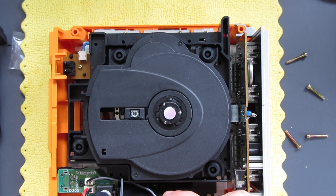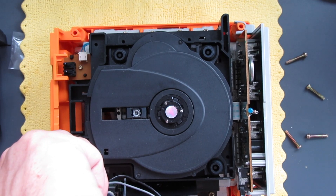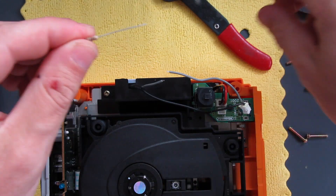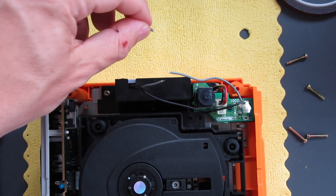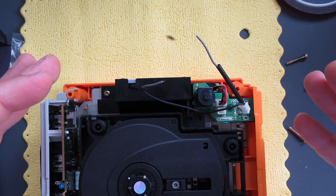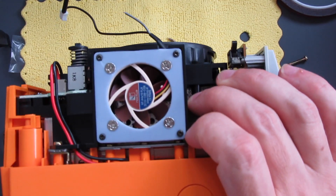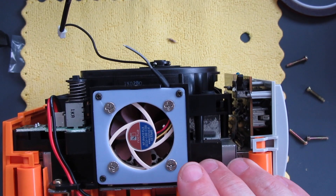So I've got two options: I could open this up, take the resistor out and solder it in line with my red wire, or - which is probably what I'm going to do because it's less messy - just take a 100 ohm resistor and put it in line with my red cable. So it's the red and black wire inside that I connected up to the gray and black wire out here. I need to get the resistor in line with the red wire - probably safest to do that by unplugging the cable and moving it out of the way. I'll cut through there, strip both ends. I also think there might be a slight issue with too much pressure on the corners of the fan where I've attached those, so I'll undo those screws ever so slightly to ease the pressure off so it can absorb those vibrations the way it should.